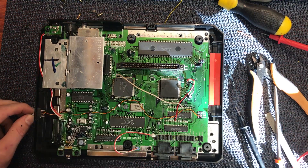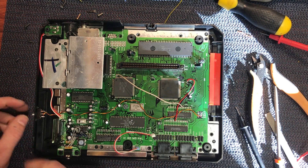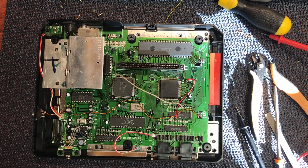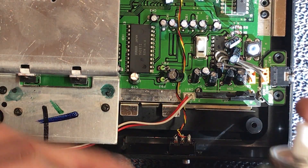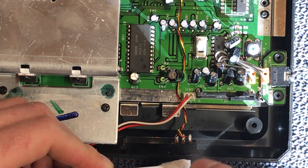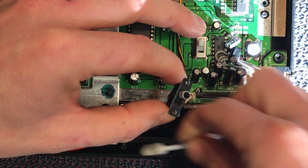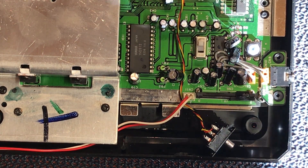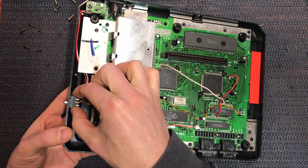To mount the switch, you could put screws through the holes, but I find super gluing it in behind is completely fine. Before you glue it down, clean the switch face and the back of the plastic with isopropyl alcohol on a cotton bud - fingerprints aren't going to help the glue stick. Let that evaporate - about 30 seconds to a minute - then you're okay to go. After about 10 minutes to fully dry, it's rock solid. Just a bit of super glue is pretty good.